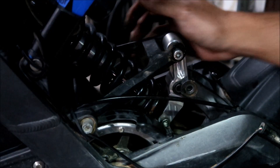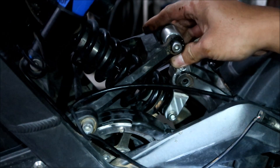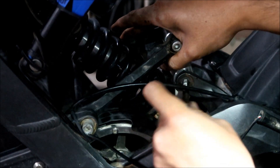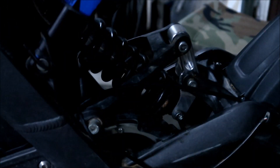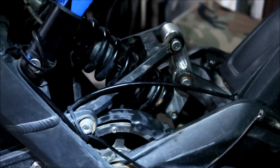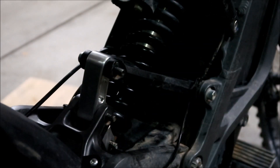I've done this a lot of times. Move the swing arm up until the hole lines up, then stick the bolt in when it lines up. If it doesn't want to go in, just shake and rattle it so it pops in. It's pretty much installed already. Now the last thing is to put the nuts in and torque it. I've got my torque wrench set to 22 foot-pounds — that's the spec for the linkage bolts.